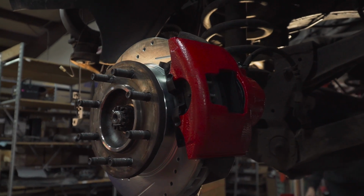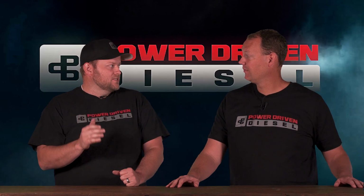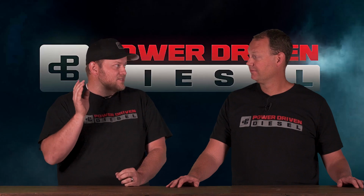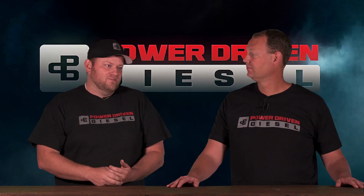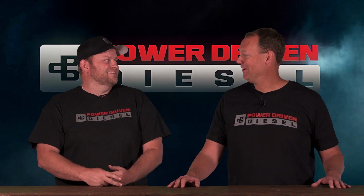Yeah, because sometimes the factory calipers get a little stiff, and on my truck actually, I ruined one of the rotors over the past 4 years because my caliper froze up. So I was like, we're gonna give these guys new calipers, and I mean, might as well get the red painted ones, right? They're powder coated red. Red means fast or slow, I guess, if that's what we want to do.